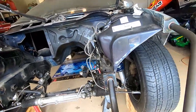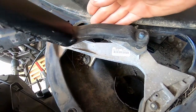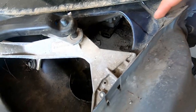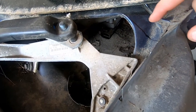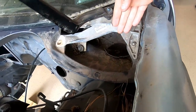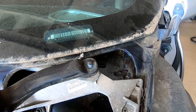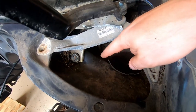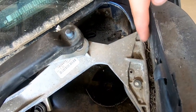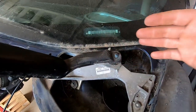I've got a body saw as well if I need it — invest in one of those if you don't have one. When you follow this contour near the windshield, I've made one cut this way instead of coming all the way back up in there. You can do it either way, but I'm going to make the cut here. The firewall when it goes straight up is ending about right here, maybe right underneath this bracket, so you're going to have this whole void in here. Once you make the down cut through here, I'm just going to follow it down and cut along this seam seal up behind this bracket, straight up until you hit this line, so that whole chunk is gone and it's straight up with the firewall.